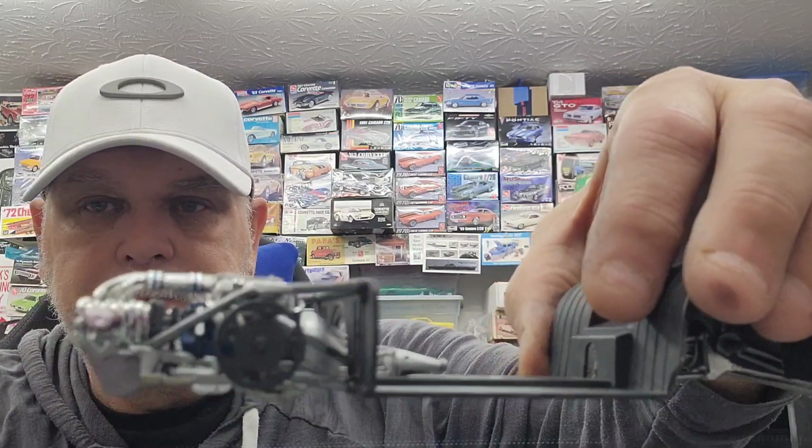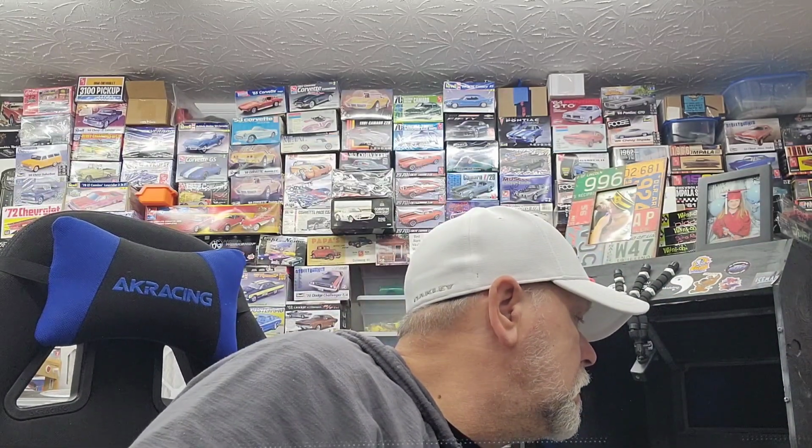And we did shave a little more off of our engine plate. We got to touch up the bottoms of that to allow the engine to come down a little bit more, and mainly tuck down forward because the front of that Mustang slopes down. But we did achieve it, and you would not be none the wiser. That's how it sits in there. So it's like the old or the new pro-charged engines, only it's a dual supercharger on it, and it's going to look really good in there. So we're happy with that, and that's pretty much it.